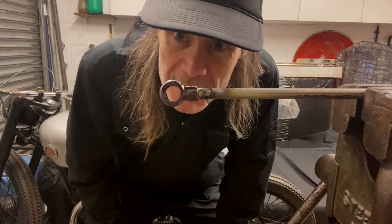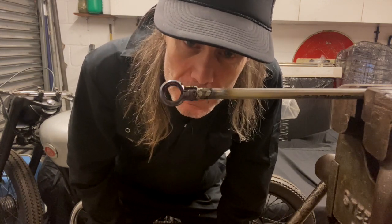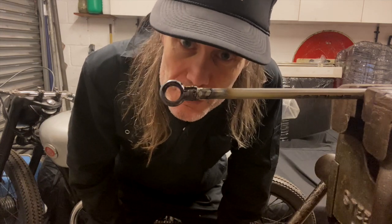It looks pretty messy and you wouldn't want to put that on your vehicle as-is. We'll see what it looks like when we dress the joint up. You can see it's got solder slag all over it and burnt flux - looks pretty horrible. I'm going to run it through the wire brush, then hit the excess solder with 80 grit sandpaper, then 240 grit, then 320 grit sandpaper, and we'll see how it comes out.